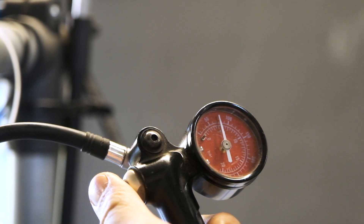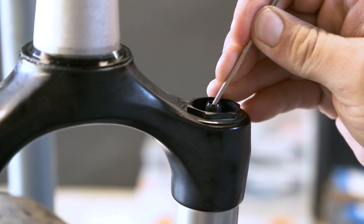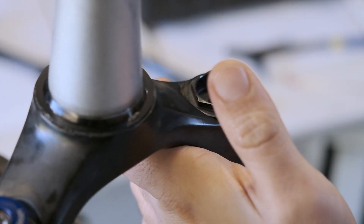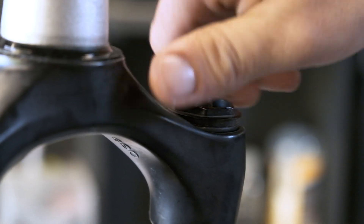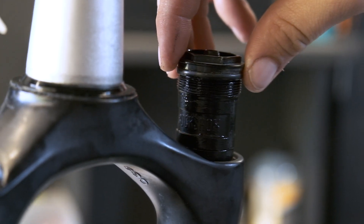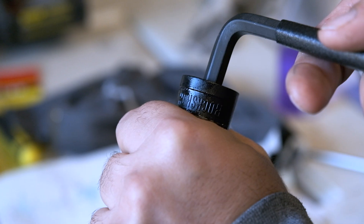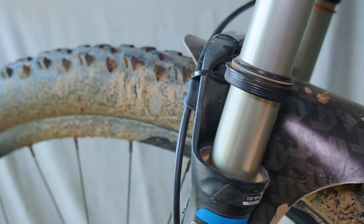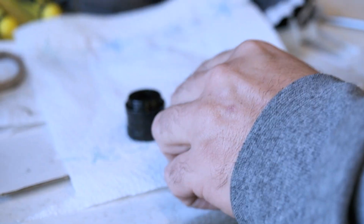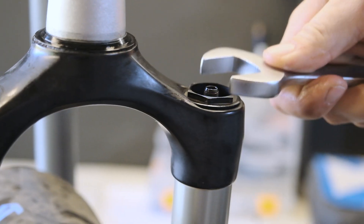Now the service is officially over. You can fill it with air and build it back into the bike if you want. But I'm also removing an air token from my fork. A new Reba suspension came from the factory with two tokens which provides pretty linear movement. I changed it to four, which is the maximum for my model, making the fork much better — the first 3 to 4 cm is plush but still pretty stiff at the end, suitable for my riding style. However, in the summer it happened multiple times that the rubber seal was blasted from the lower because of an air leak from the chamber, possibly because of the high pressure caused by the fork tokens. So I'm removing one to test if this season would be better.